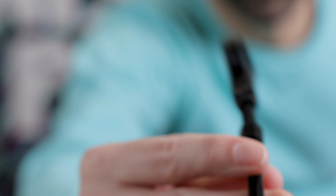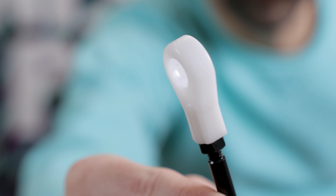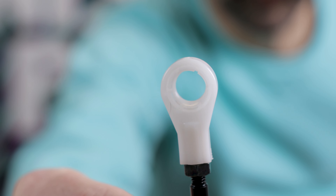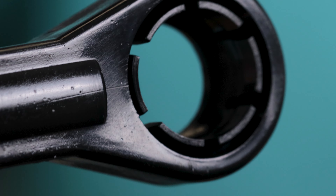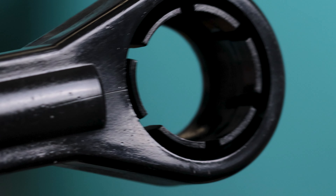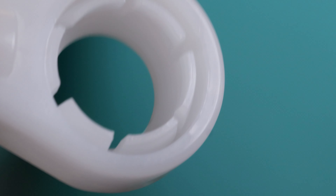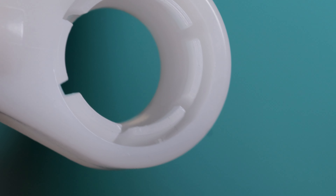The headlight motor link for the pop-ups. A lot of reasons you could replace this, but the main reason is the little teeth will break off — it's like a wiper linkage almost. Once the teeth start breaking, it doesn't function properly anymore. Really popular. Every time we bring these up, people are like 'oh God, I can't believe you can still get that, I need that.' It's shocking the things people assume are just discontinued and aren't.